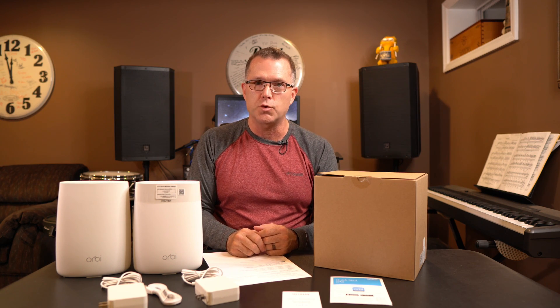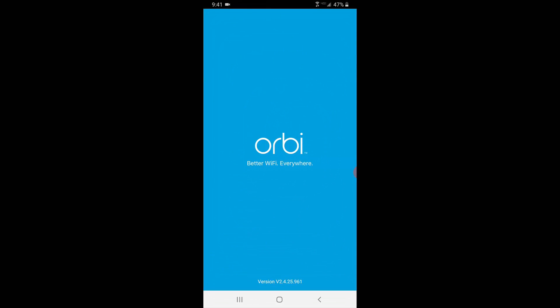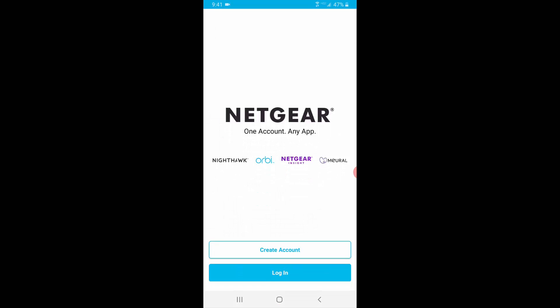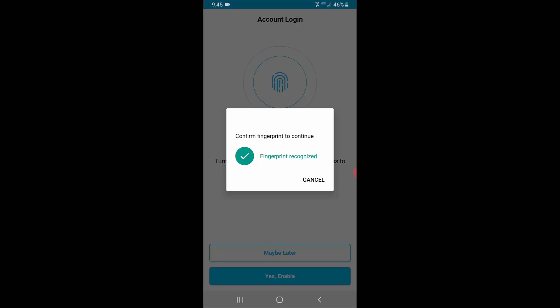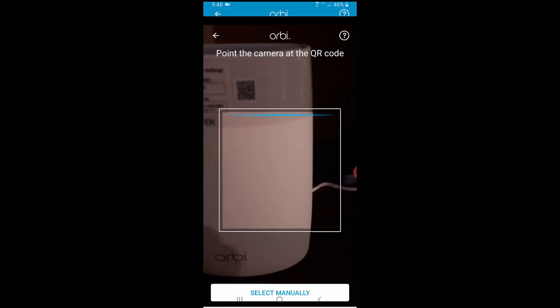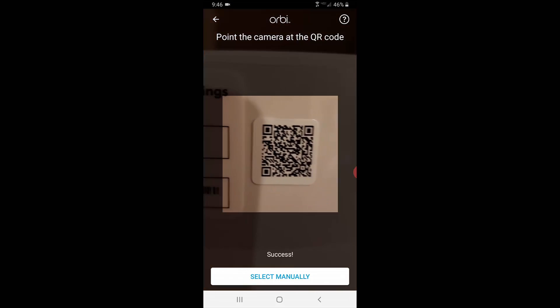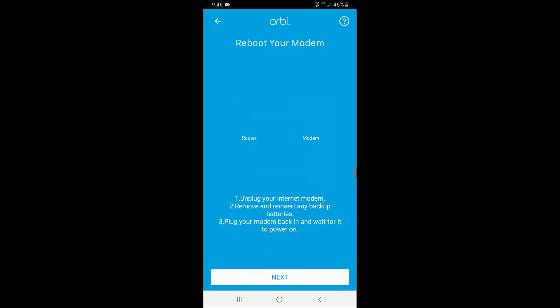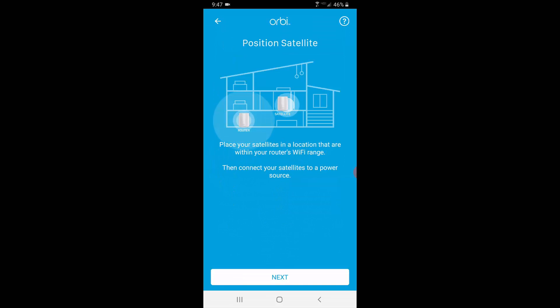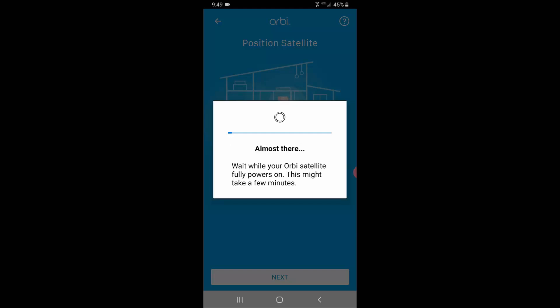Let's check the Orbi app on my Android phone and find out what we have to do to set this thing up. We've got the Orbi app downloaded from the Play Store and we're launching it. I click get started, log in with my existing Netgear account and enable touch ID. I tell it I have a new product I want to install, allow it to take a picture, and scan the QR code right on the front of the router. This automatically gives it the Wi-Fi SSID and the factory default password. It wants me to reboot my router, then tells me to connect the Orbi to my router and go place the satellite module where I want it and power it up. I've got that done — I'm speeding this up a little bit so you don't have to wait for me to walk upstairs and do all this.